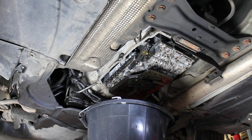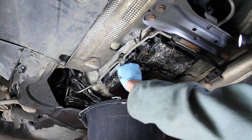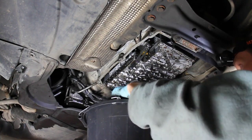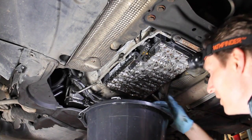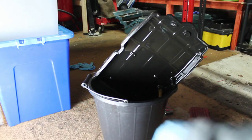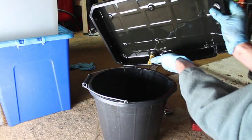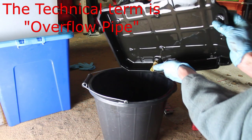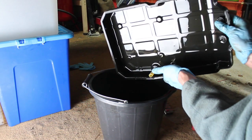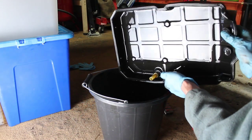Okay, so that filter's almost finished draining now. I'm going to go ahead and see if I can pry the filter down. It just pops down. Just a couple of things to comment on — the reason why the pan doesn't completely drain when you take the plug out is it has this filler nozzle. I tend to call these a snorkel but that's not their technical name. Once you've taken the plug out the level stays above that, so that's why there was some left over.